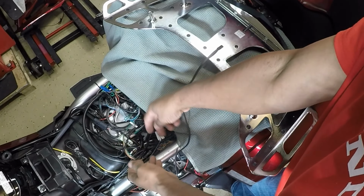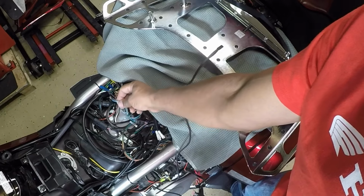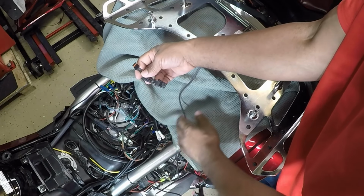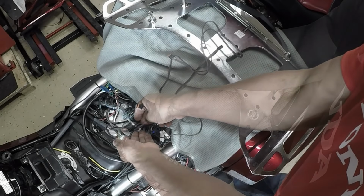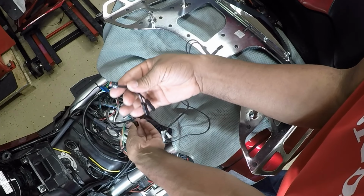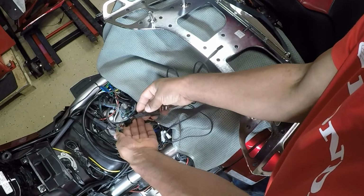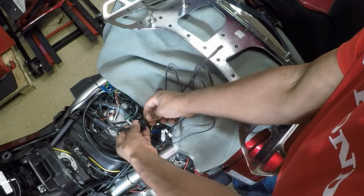And since the Honda Goldwing is actually out of connections for any additional accessories on the Goldstrike harness, I'm going to plug in the Y splitter. So I can plug in on any side. For this installation, I'm just going to find one on the left side. So on the left side, I'm going to disconnect one of the connectors. I'm going to take the Y adapter and carefully plug it into the connector. Snap it in. I can take one of the existing connectors that I disconnected, plug it back into the Y splitter.